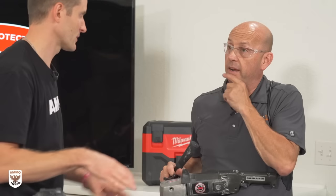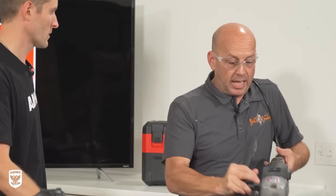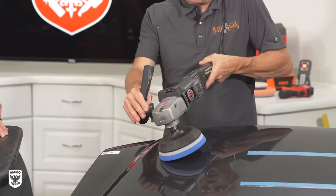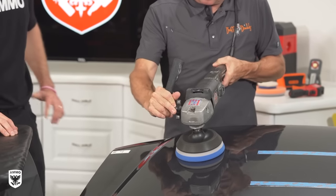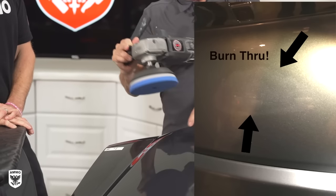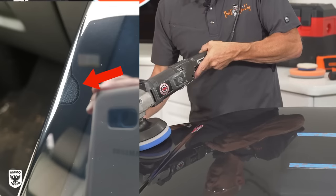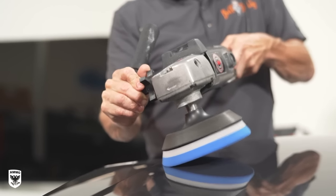One of the reasons rotaries are scary and many people avoid them is because they can create a lot of polishing energy. The weight combined with tilting focuses all that torque and force into a small area instead of a large one — that's where you get rapid paint removal and burning damage. On edges, they really grab, can tear your buffing pad, burn the edge, and can actually hurt you. The benefits and drawbacks are immense in terms of learning to use one properly.